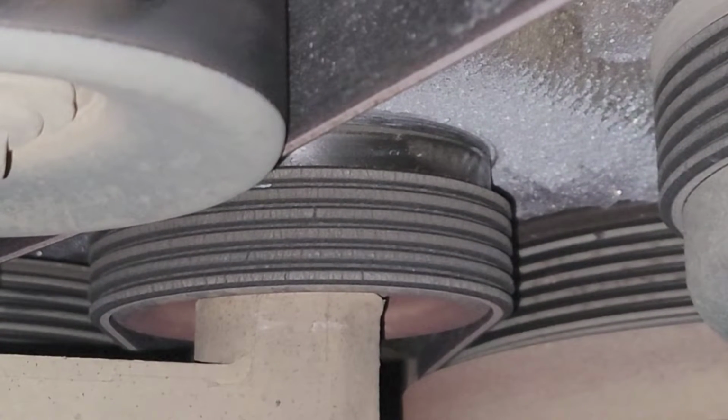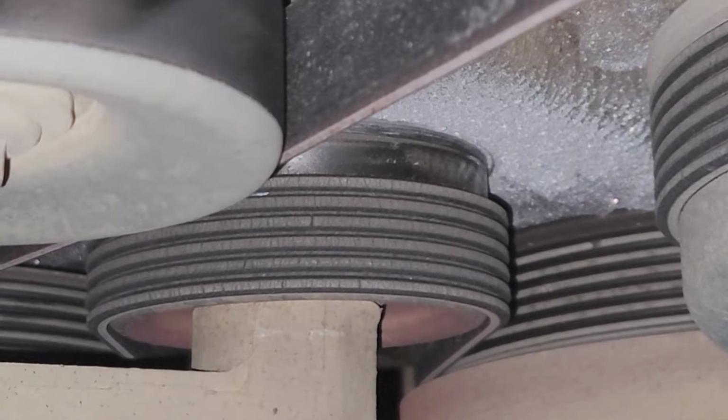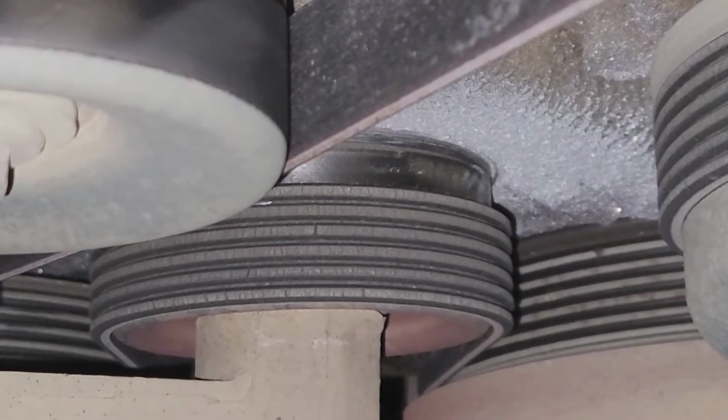So, yeah, it's a good thing they brought it in, because this thing would have bored a hole right through the timing cover. So I'm going to have to get a tensioner and a belt and get this thing apart and see what's going on there. That's going to be the first step. Actually, let me give the truck a full look over, and then I'm going to get that ordered and on the way. And I won't take it apart until I have the parts in my hand. All right, let's get that.